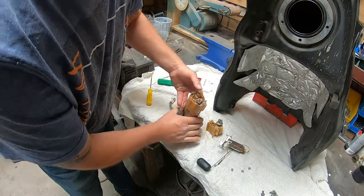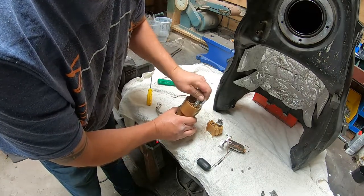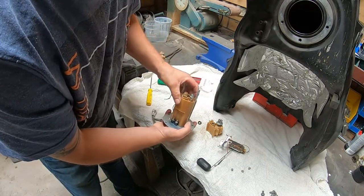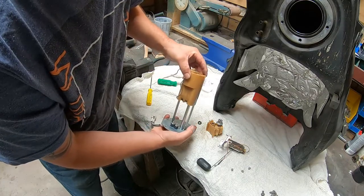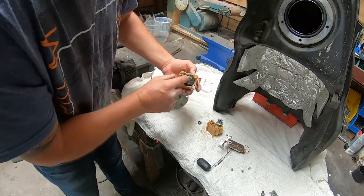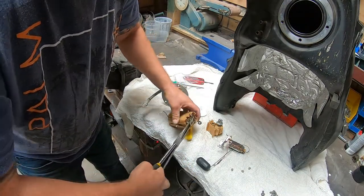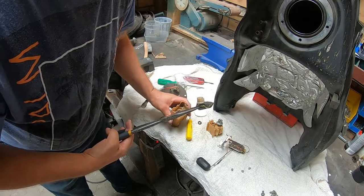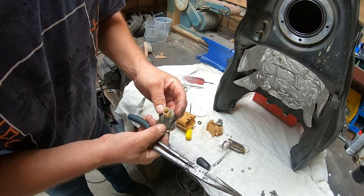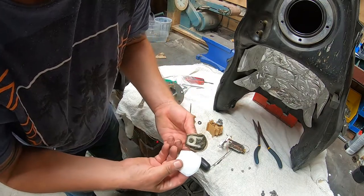What you've got to do next is slip that housing off — I'm going to take that O-ring off to make it a little bit easier to get to. Just slip that housing off, and that's where your filter is. She's looking pretty worse for wear, this old filter — looks pretty dirty. Here's a comparison: a nice new white one.